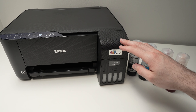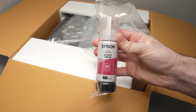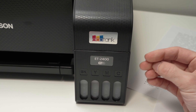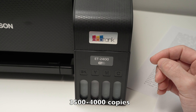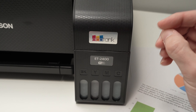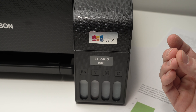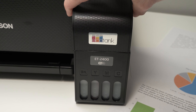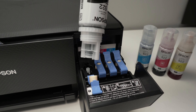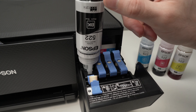Just like any other Epson EcoTank printer, this does not use ink cartridges. It comes included in the box with four bottles: one black, one yellow, one magenta, and one cyan. These are supposed to last 4,500 copies. Based on what others have experienced, you can reach 4,000 without a problem for standard documents. If you're printing pictures on glossy paper, you'll obviously print fewer pages due to higher ink consumption. Loading the ink is very easy — just pull open the small door — and everything can be done in under five minutes. It's not messy at all; the bottles are designed so they don't spill.